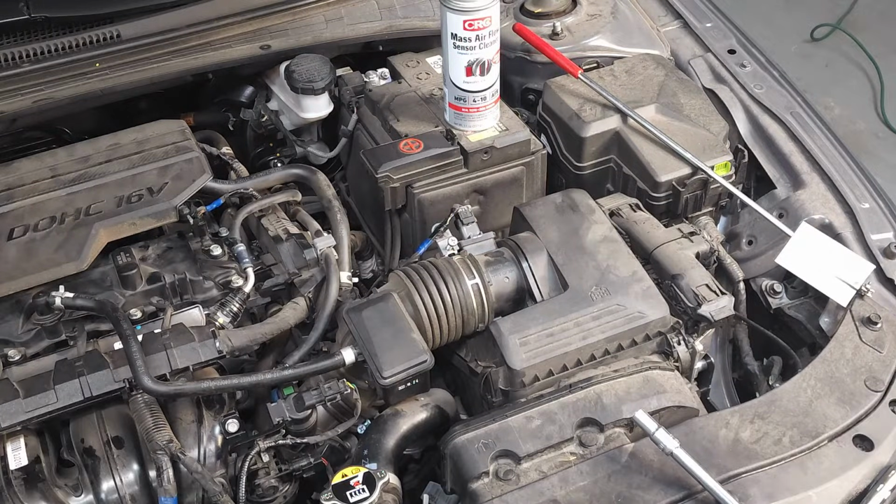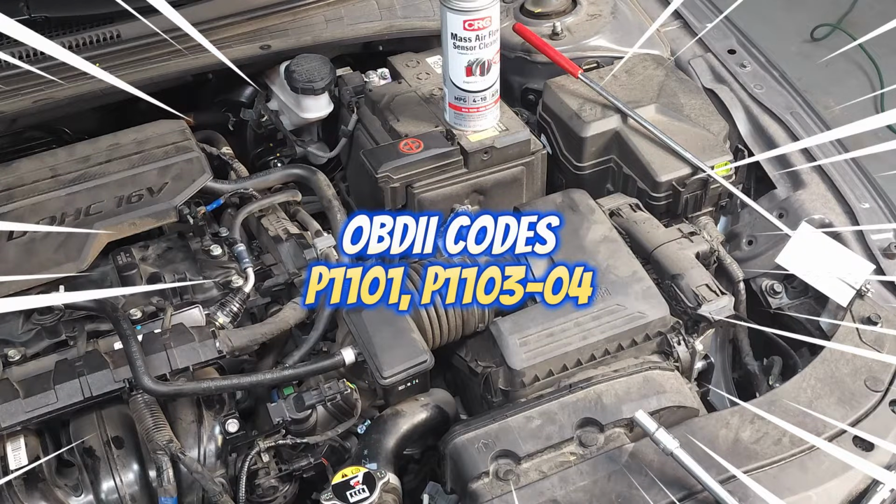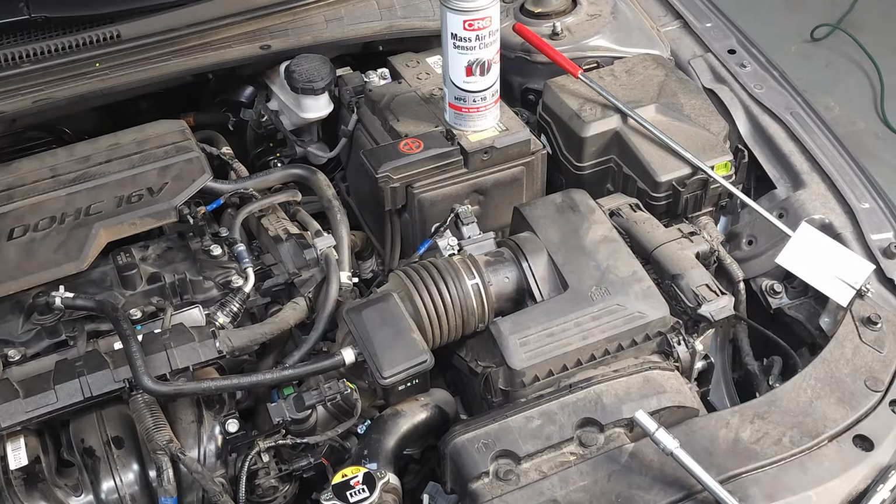Symptoms associated with a faulty MAFS airflow sensor include hard crank, no start, and engine speed surges at idle. You also have a check engine light with trouble codes P1101, P1103, and P1104. So you might ask, what does this part do? It measures the amount of air entering the engine, which helps to calculate the correct air-fuel ratio.